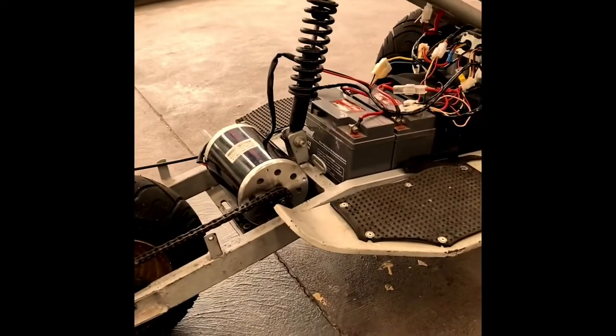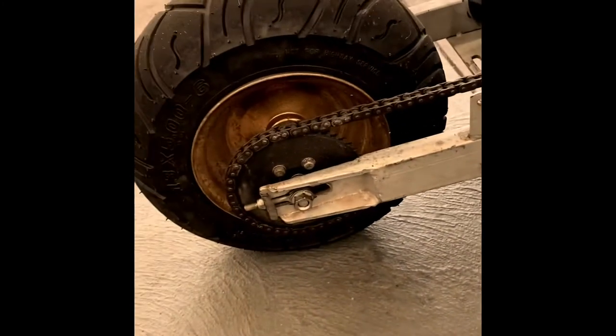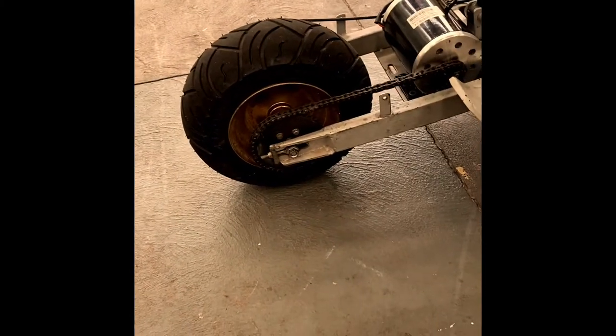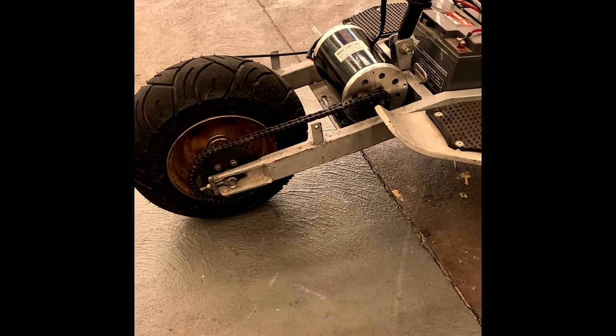The only problem is, it's not that good for golf. It doesn't like hills because the rear sprocket is 44 tooth, so I'm going to change that to a 64 tooth and put on a bigger chain, which I think I'll need. Then it should drop it down to about 25 kilometers an hour, I'm expecting. The top speed, especially down a hill, is 40 kilometers an hour, which I think is a bit quick for what we want on the golf course.